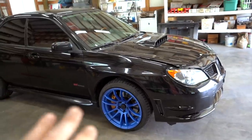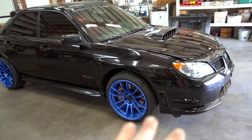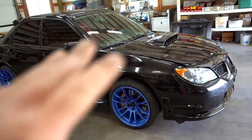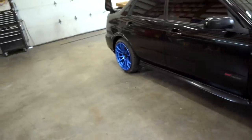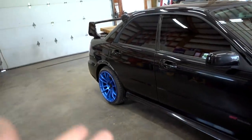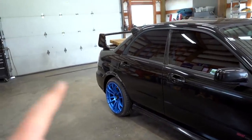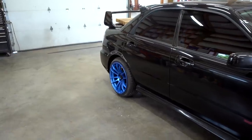First up today is we're gonna get this thing an inch and a half lower to the ground. I do wanna measure before and after to see if it actually is a true inch and a half, or if it's more or if it's less. And then I wanna go drive the car, see how these springs ride. While we have the struts off, these rear struts clunk really bad, and there is a very common fix. I've done it actually before, the STI rear strut clunk fix. We are gonna be doing that today. And how you fix that is by packing the rear strut full of grease.